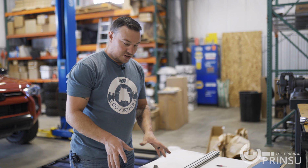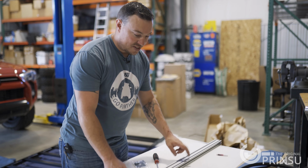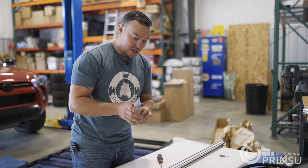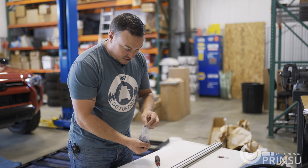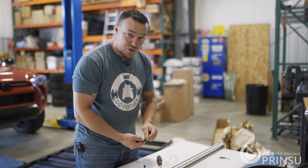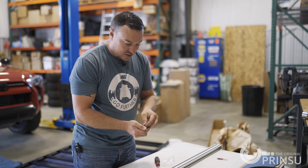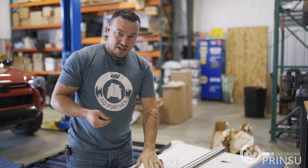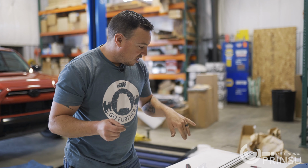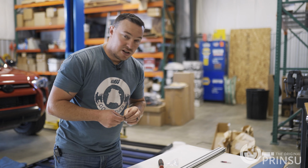Okay, moving on, now we're gonna talk about assembling the wind deflector. So we have the silver crossbar, that's indicated to go with the wind deflector, and we have our bag of hardware that contains the hardware for this. Inside this bag will be some Phillips head screws. You can go ahead and get those prepped by installing the washer on them and some Loctite. And then these T-nuts, we can insert those into the crossbar. Make sure you put the threaded side facing up. Once you get all these slid in, then you can get your noise reducing trim applied and start getting this bolted together.